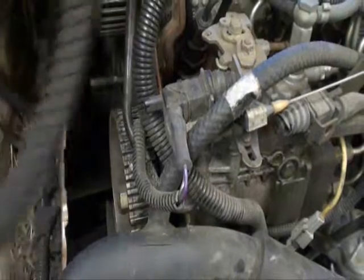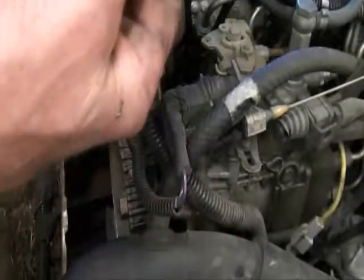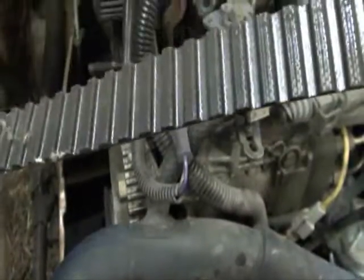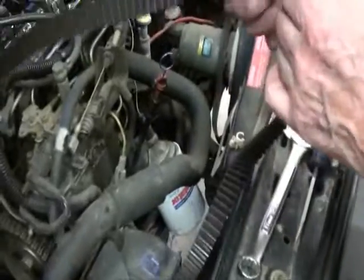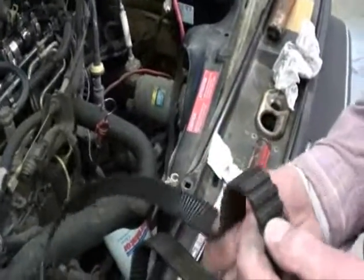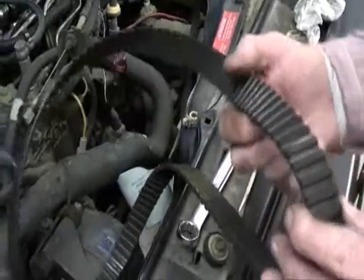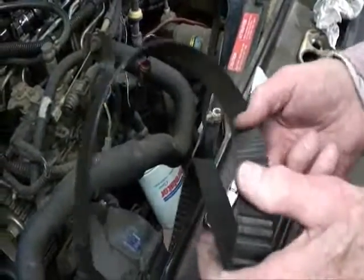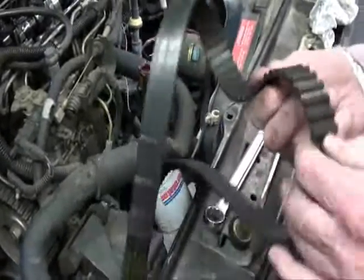Slide this belt off the front, work it off a little at a time. Tensioner out of the way, pull this belt off. Just for giggles, you want to look at your belt and see how close you were to breaking. This one actually doesn't look too bad. But he's got 160,000 miles on this car, and generally you change the timing belt about every 60,000 miles. He's got 160,000 on it and doesn't remember when he changed it last — so it's time to do it. Better safe than sorry; end up leaving you beside the road and then you've got to put valves and whatnot in it.